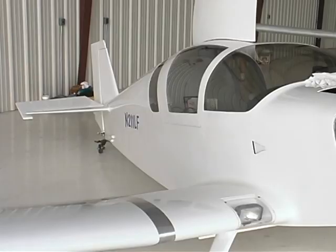This is a KR2, N number 211 Lima Foxtrot. It's a KR2 modified. It's got a 24-inch stretch on the fuselage. All the other dimensions on the structure are basically stock KR2. The canopy is totally different. It's built in place. The fixed windshield is the forward portion of a Pulsar canopy, and the center glass is out of a KR bubble.